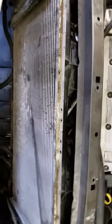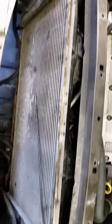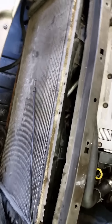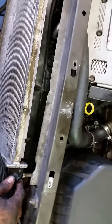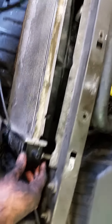I can't tell you what to do about that. I have all the tools to do this job, and it did make it easier. I used stubby ratchets, ratcheting wrenches — things to make this job easier. I found most of it was done from the top. If you remove that bracing, you remove the condenser, you're going to not have to completely remove the radiator, although you are going to have to undo it for the most part.